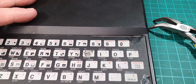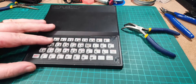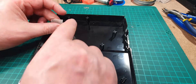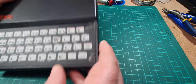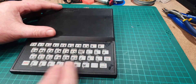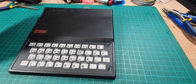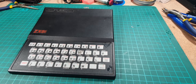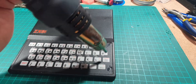Let's zoom out a bit. On this board the cable — and there's where it broke off — comes through this hole here. I think what we need is the heat gun to warm up this old keyboard so we can soften the glue and gently pull it off. Let's get the heat gun warmed up. Right, it's on, so let's just very gently warm this up.